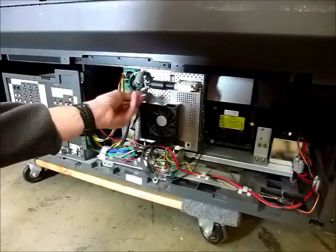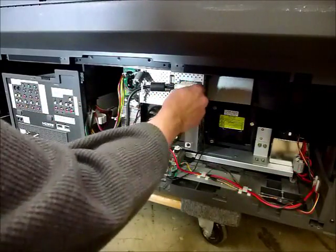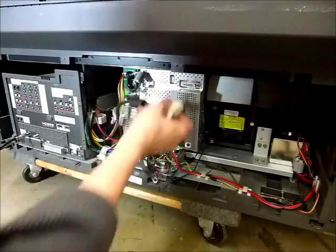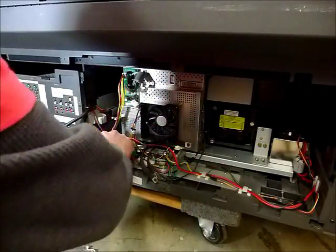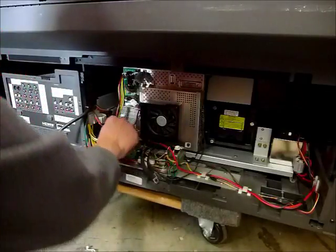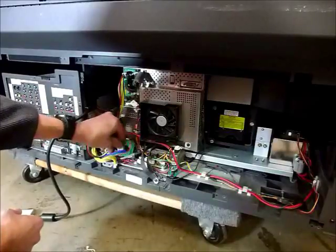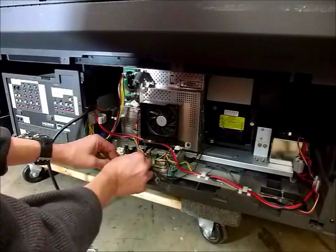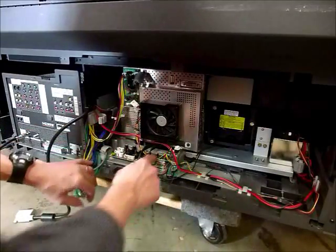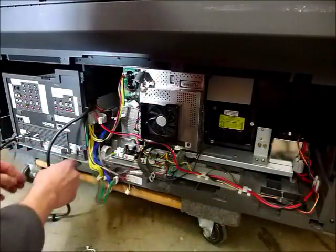You'll want to disconnect and move this wire out of the way, then pull the LVDS cable out of the way — it just unplugs, release all the clips. You'll also want to unplug the majority of the wires from the interface board. There's one that has one screw for the ground wire — remove that one. These two don't need to be removed; they'll come out with the light engine, so you don't have to worry about them.